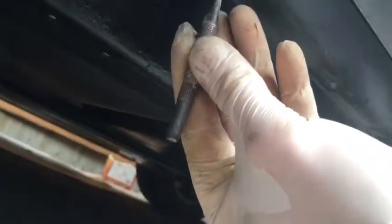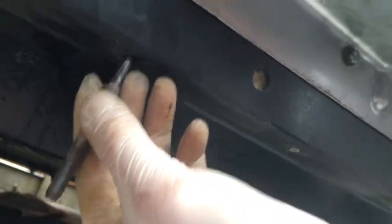So what I did - what the guys on the forum suggested - was an angle grinder to basically grind each remaining head off these. Someone also suggested drilling them, but where it's obviously soft aluminium on the outside, plastic, foam, fiberglass, whatever, and then a hard screw, it's just really difficult to drill. If I drill all 24 of those out, drills just aren't up for it. So somebody else on the forum suggested just get rid of the head - get a punch and punch it in. When you punch it in, you can tell it goes into some type of foam, which is exactly how it feels.